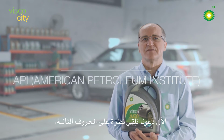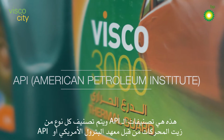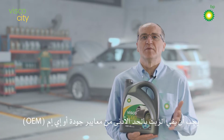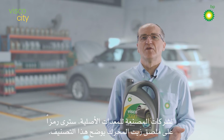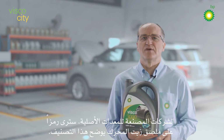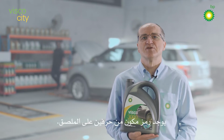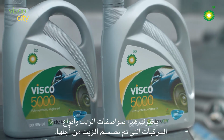These are the API classifications and every motor oil is given a rating by the American Petroleum Institute. The oil must meet minimum OEM, original equipment manufacturer, quality standards. You will see a symbol on the label of an engine oil showing this rating. A 2-letter code is featured on the label. This tells you the specification of the oil and which types of vehicles the oil is designed for.